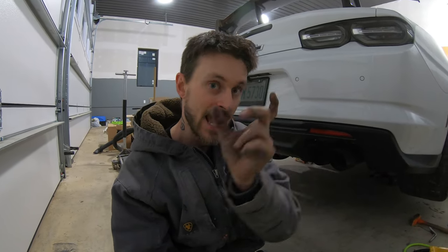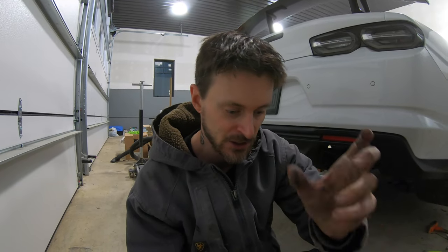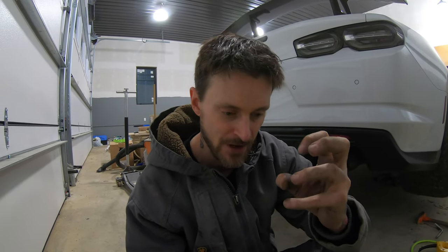So within the mid pipe, I have a little bit of movement, and then there's the X pipe and then kind of the axle pipe. All of those aren't probably as deep seated as the driver's side, but they're more than an inch and a half. I'm talking some of these are slip fitted almost 3 inches. So they're really in there. So I have room to work with, but I didn't really take a measurement on the passenger side of how much it is slipping over the cat. So I can probably put the V-band or the clamp on there for now.